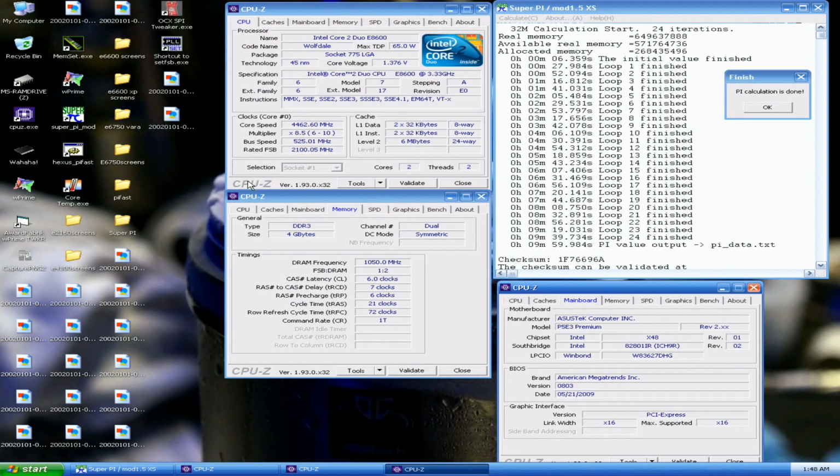So I think heat is one big issue. I think the heatsink assembly is still with the original thermal paste that was applied to the motherboard 12 years ago when it came out to the market. So I am sure I could gain a few degrees if I swapped the thermal paste of the North Bridge and the South Bridge to something like KPX. So I will definitely do that after this.